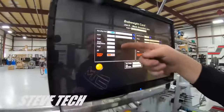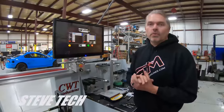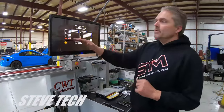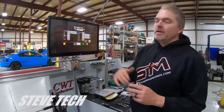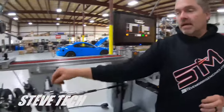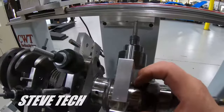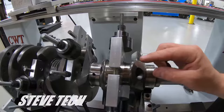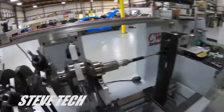It also asks for oil weight, because yes, there's oil weight in there. Typically we're going to be between three and five grams — we just use five for that number. That's the oil inside the connecting rod journal from the center of the crankshaft out to the connecting rod journal: that two, two-and-a-half, three thousandths of oil film right there. That gives us our rotating weight total.